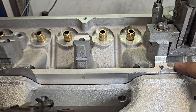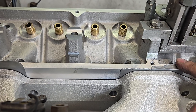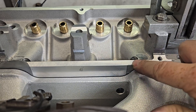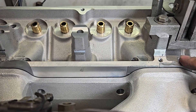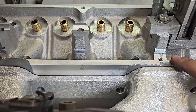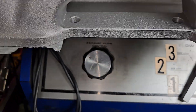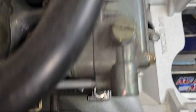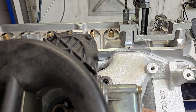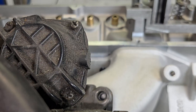I use tape because I'm actually using it as a gasket at this point — if I go on and off with the gasket I'm given, it'll be destroyed in no time. My alignment is close. Am I going to lose a few CFM? Sure, doesn't matter. You take this tape and cut it out to the correct opening so the air can get through. These ends are sealed with tape. The only way to get air through the bench is through the head, through the runner, through the plenum, through the carb. That's what you need to do to test.